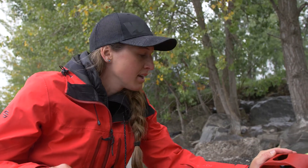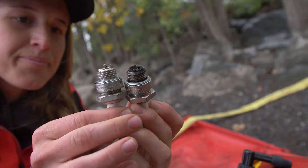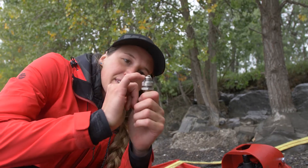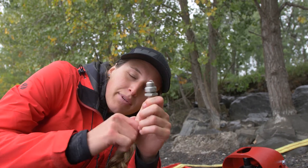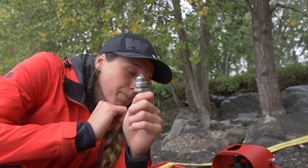There are different reasons why you'd want to change the spark plug in the field, one of them being if the spark plug is too carbonized. What happens is there is no longer a gap, and this gap is mandatory if you want to have the spark.